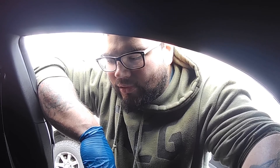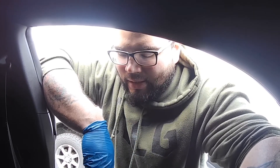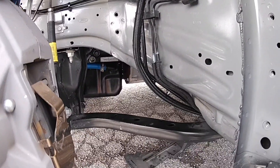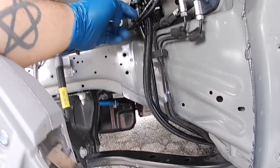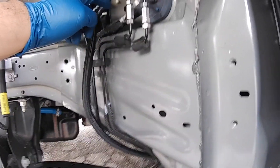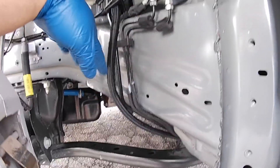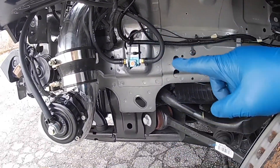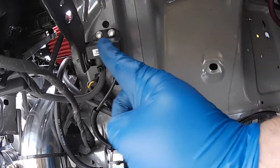Once that's done we'll be able to start data logging and tuning it. Let's go take a look under the hood and I'll show you the vacuum lines and all the other stuff. This is where I'm running my fuel line up through, by the PCV valve — makes it way easier. There's a good cutout there. There's a black metal plate here held in by six T50 bolts that you remove to get access. I've got my MAP sensor for the SCG1 over here, just zip-tied in for now — I need to make a proper mount for that.